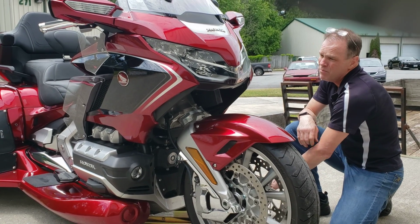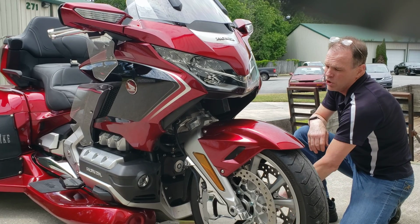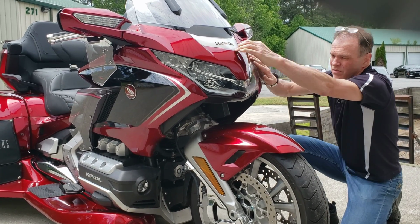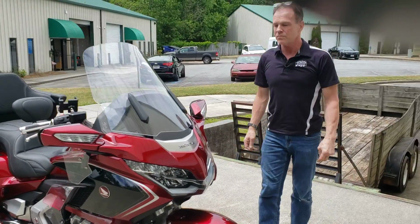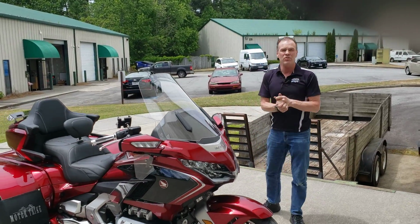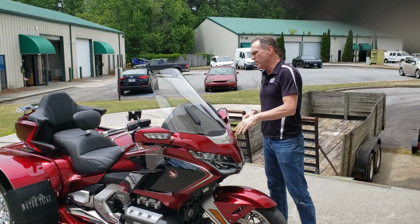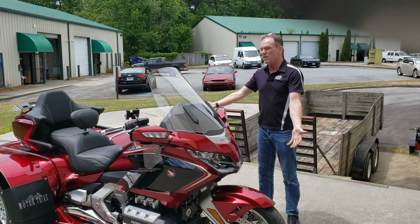All this is just wasted, available, good quality potential suspension travel, right? That could be used to soak a bump. But you don't get that with a trike. So I'm gonna encourage you to ask your trike builder to include an upgraded shock that can support the weight of the trike. And again, remember, there's no one sitting on this.